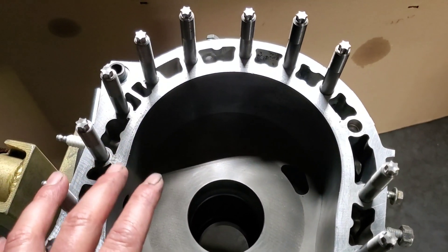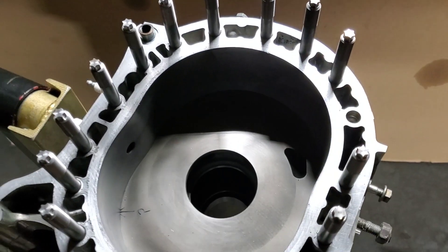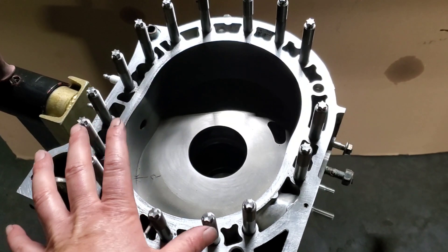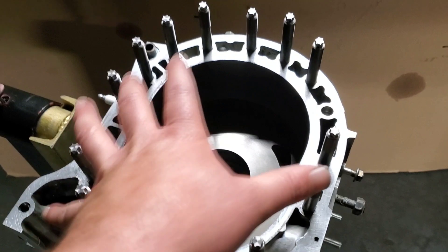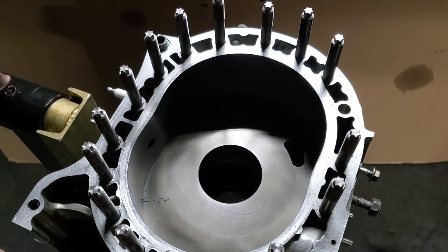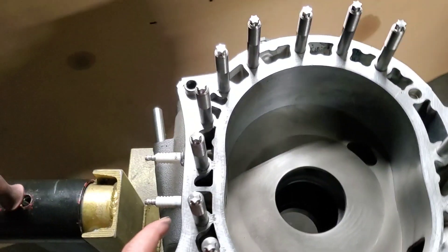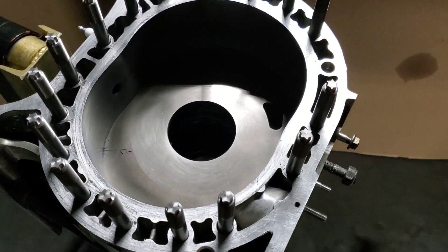When it really comes down to it, all of those are applicable aids to the motor, but the most structurally beneficial to the motor under high boost, high RPM, and high potential flex situations — which can range for many reasons — then studding the block is the best way to go.